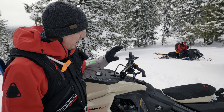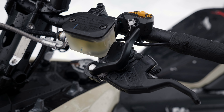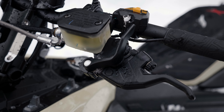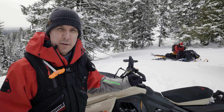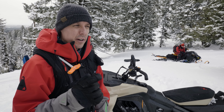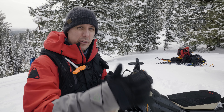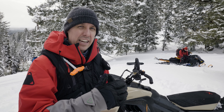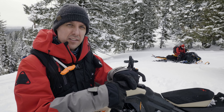First of all on the Summit X this year we've got the adjustable brake lever. This was a feature on the Summit X with Expert Package last year and it's now been brought over to the Summit X. We've been riding sleds with these quite a lot this year and it's nice to be able to just dial in that distance between the lever and the bar just to get it fit for your own comfort and your own finger length. One thing that surprised me is that I thought because I have quite large hands I'd want it farther out, but in fact I've actually been bringing it in — and that's just giving me really good control, having that lever nice and tight to my hand and to the bar.